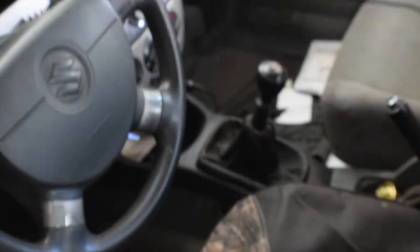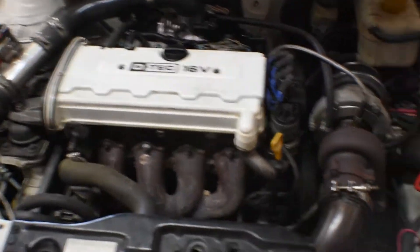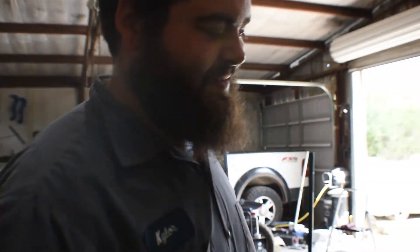The inside is still the same — we didn't change much on that. We still need to repair the transmission because second gear does not have synchros. I drove it in second gear so the gears are fine, it's just the synchro's bad — it just slips out. What I'm thinking is finding a junkyard transmission, then taking both of them apart to service them and throw some new bearings in. Finding whichever casing's in better condition, checking shafts, gear wear, and the rest. Maybe find some new shift linkage — I want something a little less loose, so maybe we'll just have to fab something up. I want a short throw on it.